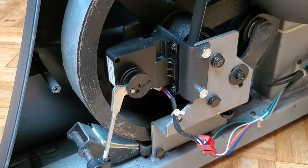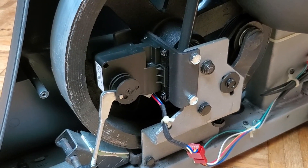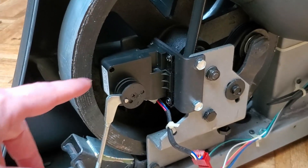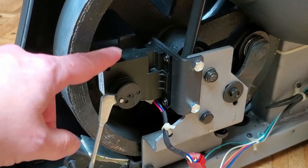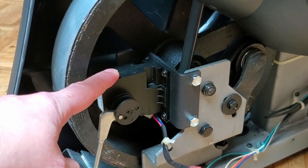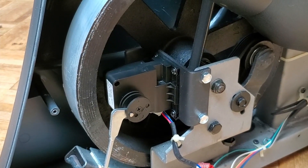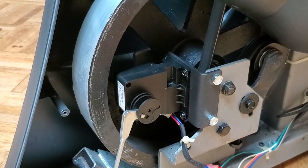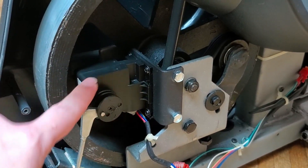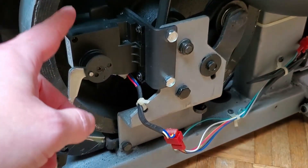So it's not that the magnet is somehow broken — it's just in the wrong place. You might think that the reason it's in the wrong place is the part that moves things around, which is turned by a motor that's in here. In this particular unit I could push all the buttons I want on the console and nothing ever happened with the motor, which might make you think it's a motor problem. But before you replace the motor — this whole assembly is about $50 — you need to check and make sure it's actually broken.